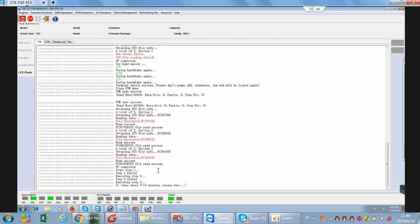After the repairing completes, we go to Common Functions, then Status Refresh, and get all the hard drive ID information and firmware information. Then we can see the drive will be fixed. So all we need to do right now is wait until the repairing completes.